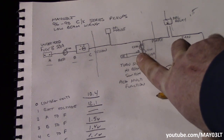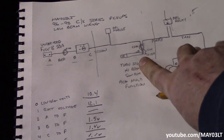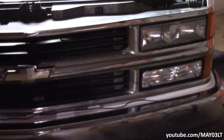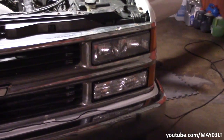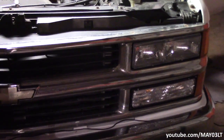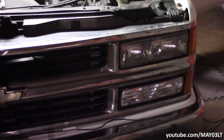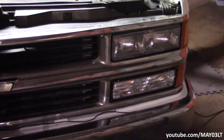I'm not okay with replacing the multifunction switch because of a voltage drop issue. This switch handles wipers, cruise control, turn signals, and high beams — the cheapies go for about $120 and OEM stuff over $200, and I'm not spending that or doing that work. The main reason is I didn't even notice the problem until I did the quad mod. Over the summer I put a different style front end on it — new lenses, new bulbs — and I didn't think there was a headlight problem. My personal vehicles have had HID headlights since 2007, so I always attributed poor visibility in halogens to just being halogen lights. But after the quad mod, when the low beams were powered by the relay I installed, they were significantly brighter.